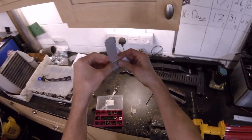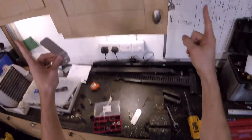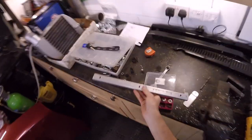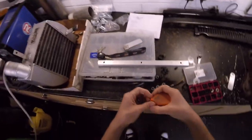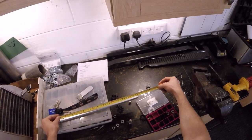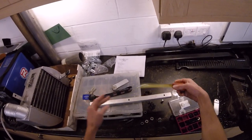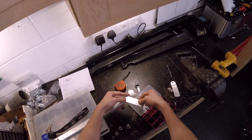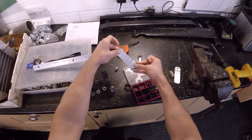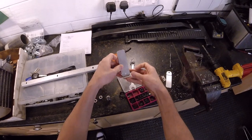Going like that would look quite nice - hang down, follow the top, hold it up. But my bar isn't long enough. The bar I got hold of is too short - I needed it to be 50 centimeters to go between the top mount intercooler, and this one is 44cm. How annoying. I maybe need to go 55cm to give me a bit of space for the holes, maybe 54. Unless I go across like that on the ends - maybe not quite as strong, it's going to pull down. I'll make up this bit first and see where we go.